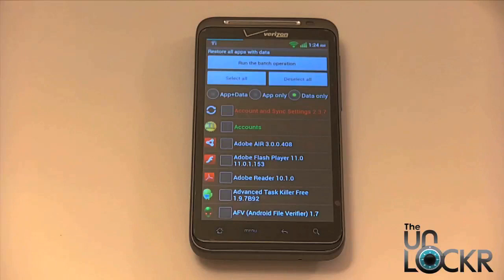So now we've got restored user apps, but we've got not restored, if that's the way to put it, system apps. So the system apps are on there, new system apps, maybe if you upgraded your ROM, but those applications are like they've never been used before. So now what we're going to do is we're going to just install the data and just reinstall that so that those applications can run with things like our previous addresses that we've navigated to in our Maps application.